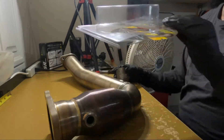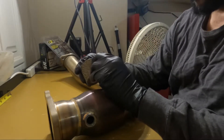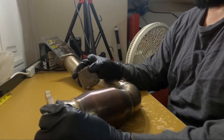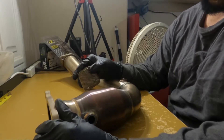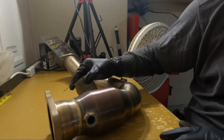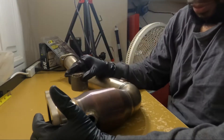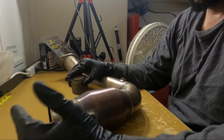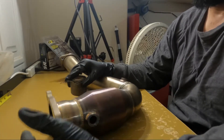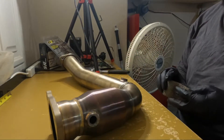I got it off — that wasn't that bad, it was fairly easy. Like I said, I had a head start on it. When I brought the car home after the drive from work it was nice and warmed up, so I sprayed the PB Blaster all over the bolts, let it sit for like five to ten minutes, and then I started breaking the bolts. I broke all of the bolts on the header loose and then got the j-pipe off.